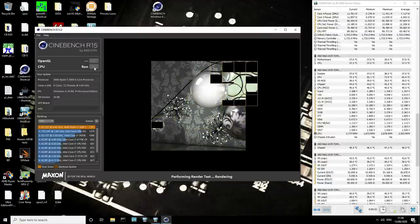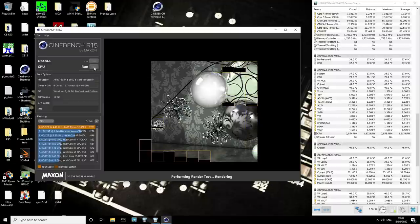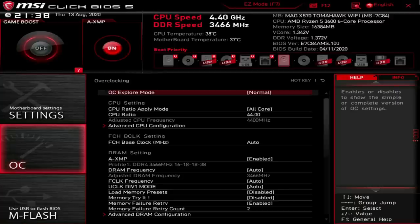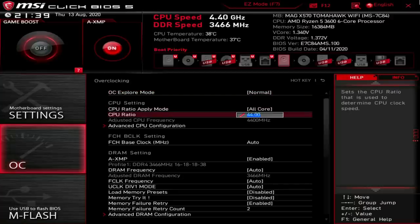Yeah, so at this point, I would just let it run Prime 95 for like an hour. And I think it just crashed. Yeah, it just crashed. So 4.4 doesn't seem to be possible. But, you know, it ran for a couple seconds, which is impressive. And I do believe the max boost on these chips is 4.3. So if you can run 4.3 on all your cores stable, that's still worth it